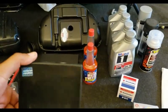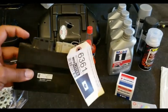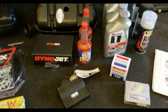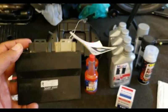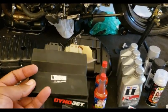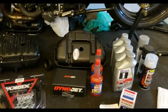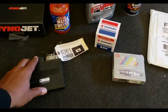Here is my 750 ECU. A lot of people told me they could take the 600 ECU I already have and reflash it for 750, but when I actually spoke to the tuner in my area, he said it'd just be best to go ahead and get the 750 ECU for peace of mind — that way they can build on top of the proper tune. As you guys know, I've got a Frankenstein bike. The engine is a 2011, but for the ECU I'll be using a 2009, mostly because I'll be running 2009 throttle bodies to fit in the frame and everything.